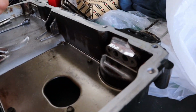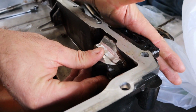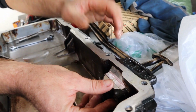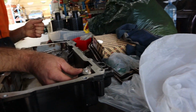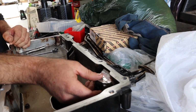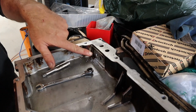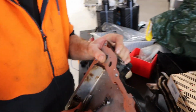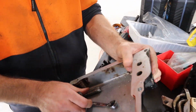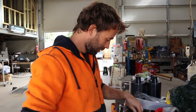Alrighty. So on the inside there's just enough lip. We'll just silicone that onto there. Yep. Do one on the outside, and that passage is sealed. Completely blocked. And then the stock filter location will be completely dry and blocked. Yeah, we can just spin a filter on it just to make it look a bit tidier. And then I'll move these plugs to the inside and plug them up. Yep. And then use an external fitting for there, off that to an external remote filter, and it'll all work. And that'll be problem solved.